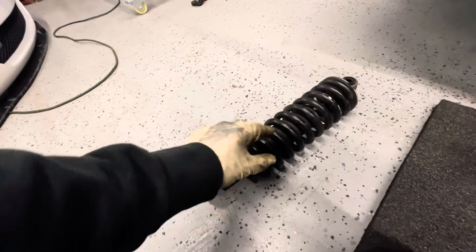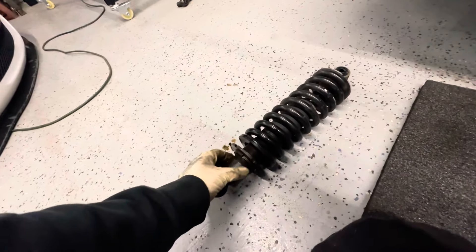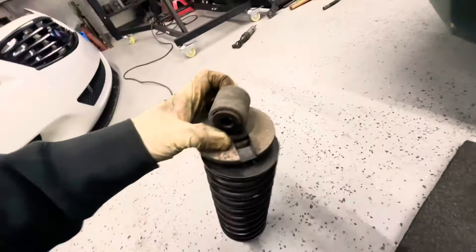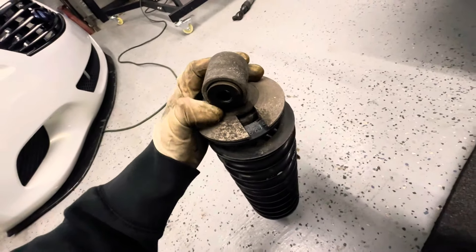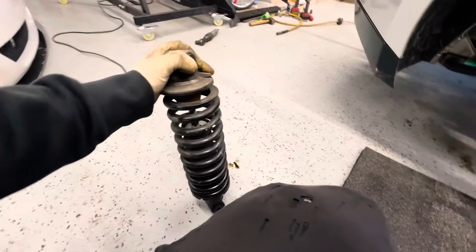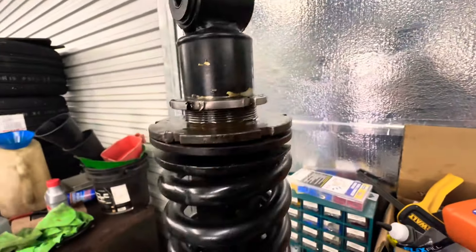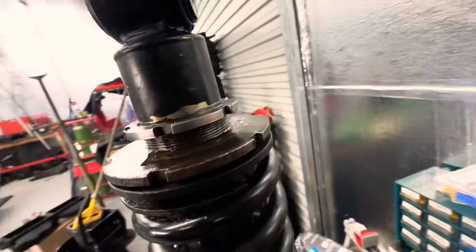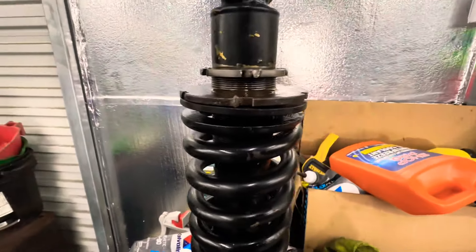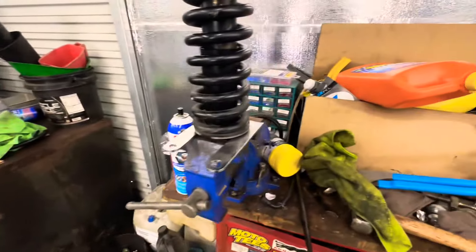We've got to push this up to give it some tension. The strut is pretty old, so I'm going to try to take off the cap on top, then take the spring out and clean those threads. I got that one loose — hit it a couple of times to free it up. I'm going to soak it with more freeze-off and see if I can get this thing to move. I need to figure out how they come apart because it's a different setup — I've never worked with these before.